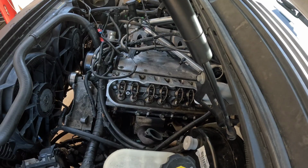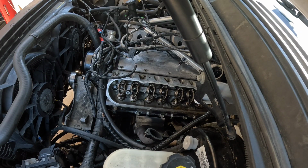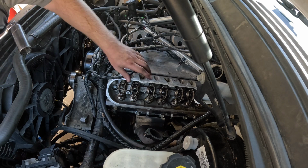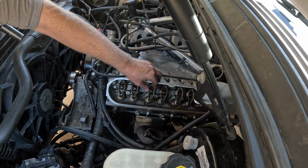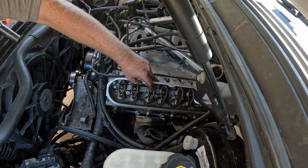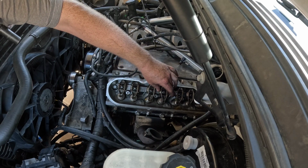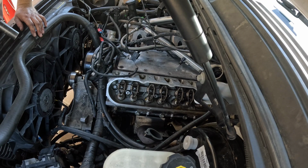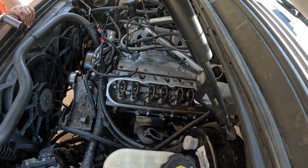I'm gonna rotate it 360 degrees on the crank with the breaker bar. And then I'll do the next. One's done, so 3. It'll be exhaust on this one. It'll be intake. I already did the intake here. It'll be exhaust. It's loose as hell. I gotta verify what it should have been. Anyways, you gotta do a 360 and torque the rest of them.